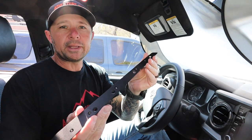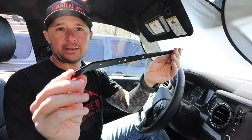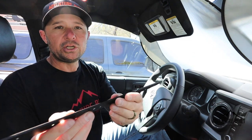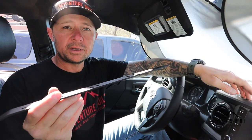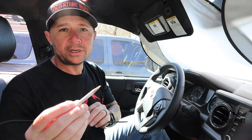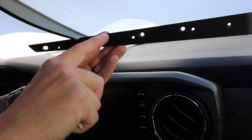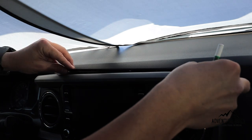Step one: you need the base plate of the 3TPAM — the powder-coated black piece that narrows with a little bend at the end. This piece fits on top of the factory bezel perfectly. Put it up in place in the bezel — you can see the little notch it will sit in. Put it in there and mark the holes with a white marking pencil. I like the Stabilo white marking pencil; it works great on plastic, metal, and wood. Take the bracket — you can see how it narrows on one end, gets thicker, and has an angle that follows the molding of the bezel.